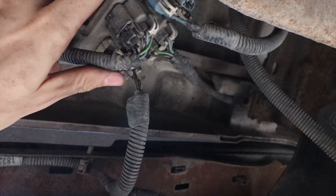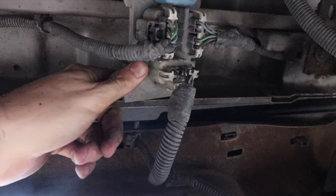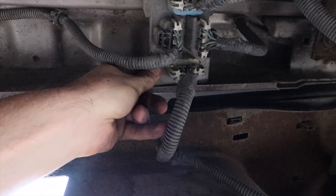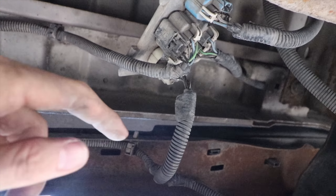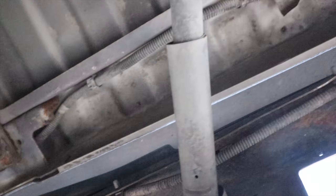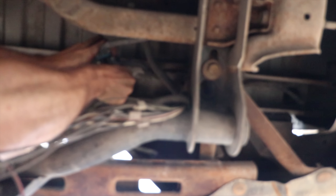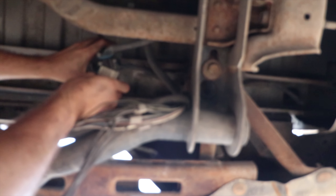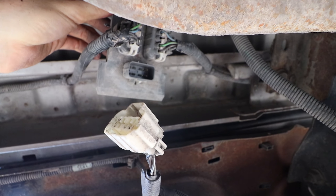Next I've got to go under there and pull the studs, and then we're going to rip this bumper off after we remove the wiring harness. We've got to get this wire off the bumper — it just unclips from this box. Mine's loose because I swapped the truck bed and didn't have a place to mount it, but fortunately it just does its own thing. These studs just slide out like that. All you've got to do is push in this little tab and pop it out — now it is not attached to the bumper anymore.